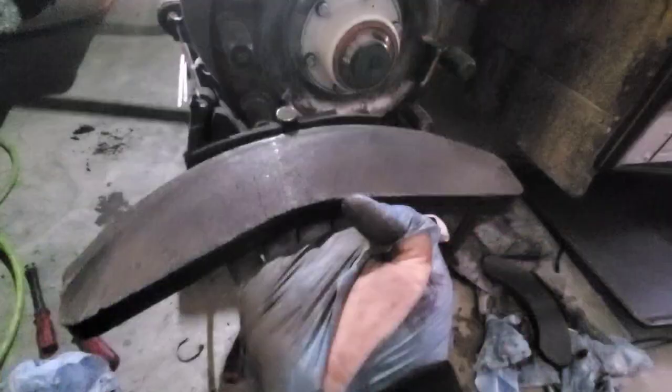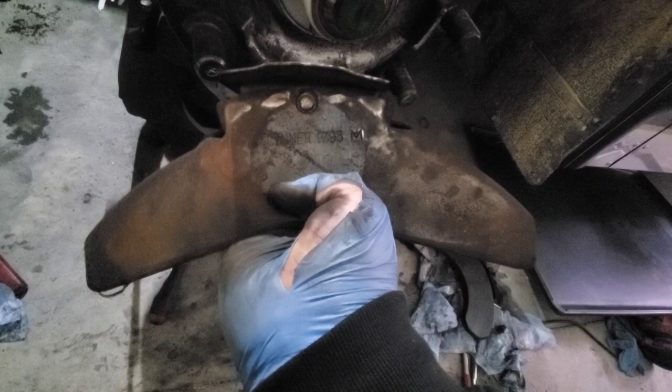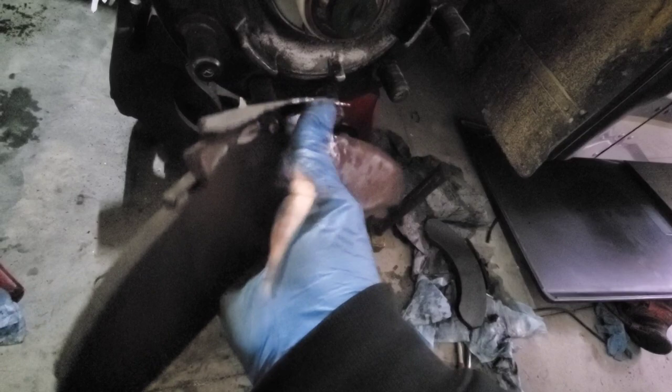Here are the brake pads out of that caliper. There's a spring right here on top which is going to be compressed against the top on both sides when it's shoved in there. If you look at the back, these two angles are coming in — they actually wedge themselves in the caliper, so these are your slide points on these two edges. This goes over the top and then the spring sits in there and it compresses down to keep this from rocking. When you go to load these, you'll drop them into the center and then push back towards the outside into these grooves.